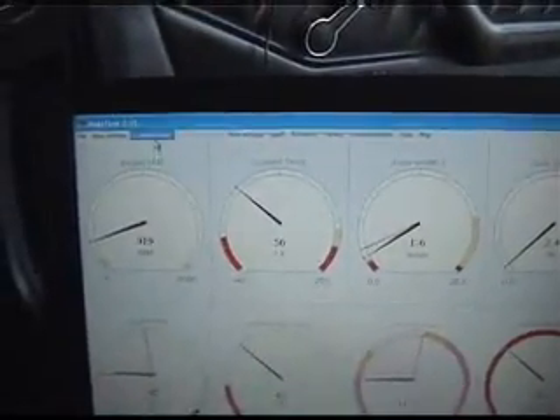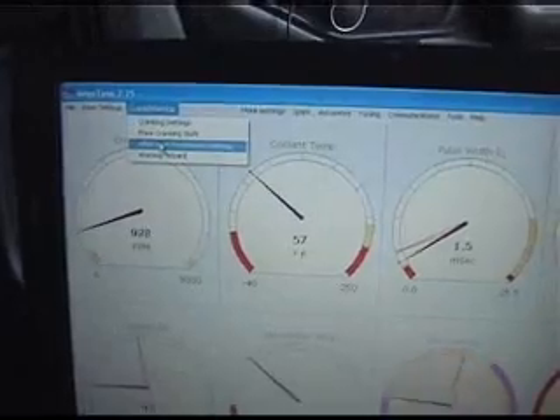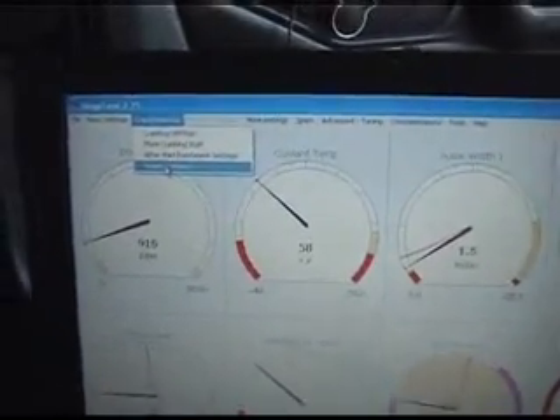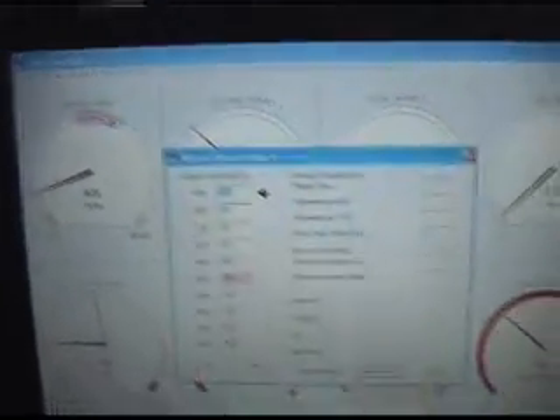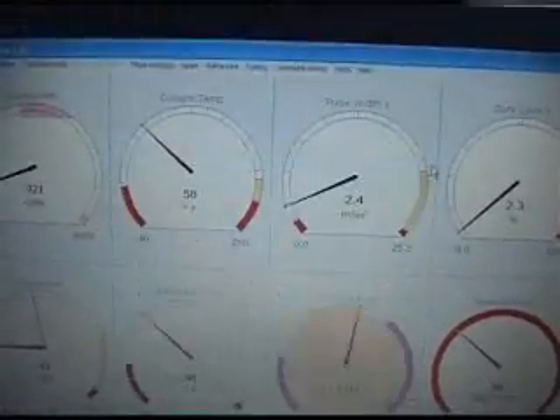So there's some cold start settings for you. It's found right here under crank and warm-up, warm-up wizard. It'll show you where it's at — now it's up to that 60-degree mark, and the pink is where it's at. I want to show you guys something else.